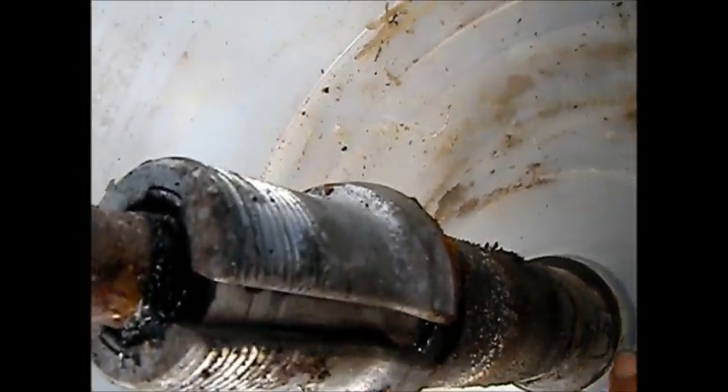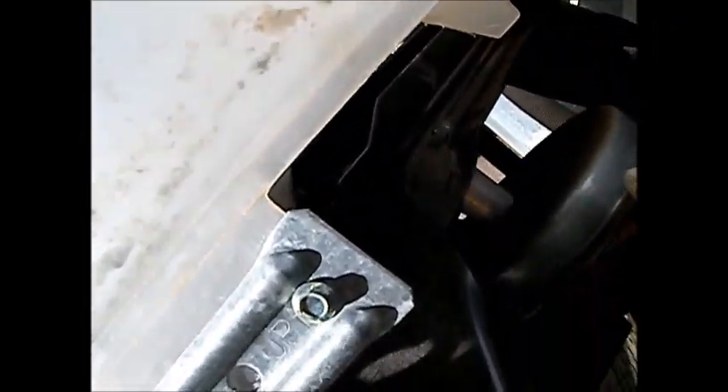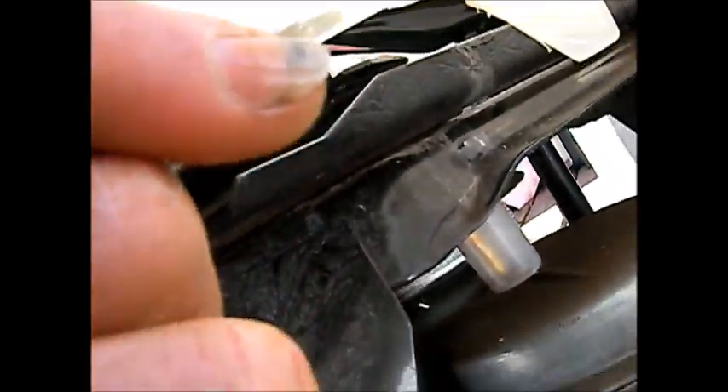You can scrub to your heart's content. There's also a possibility you may have a leak here or up here, though lately I usually just see that tub crack — because you have a stuck brake. When the machine stops, it clunks and abruptly stops. This one here I cut off — you can see it's a full square — because what it does is bump up against this thing when it stops and cause that to crack.